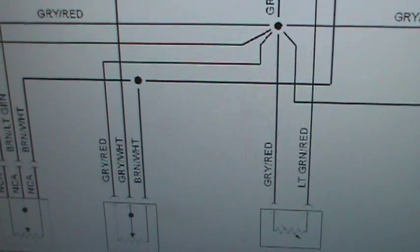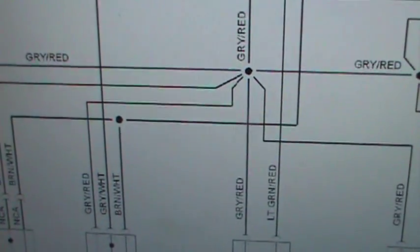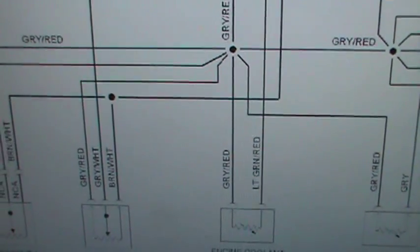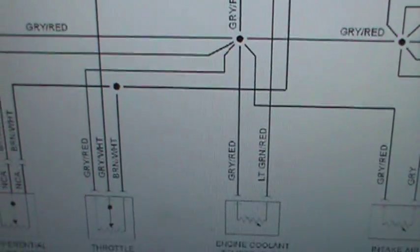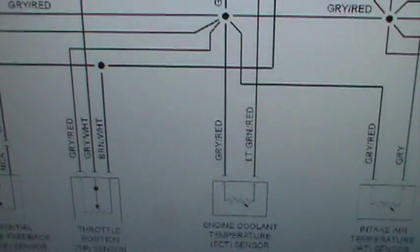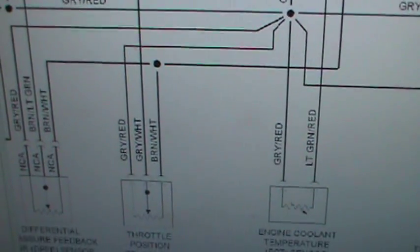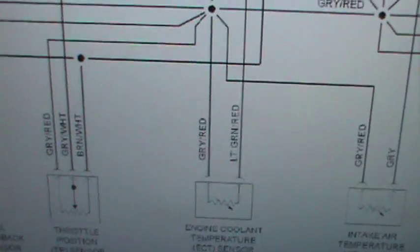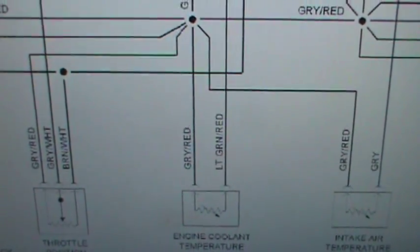You pull up the wiring diagram, you want to see which one's the signal wire — boom, one in the middle. You want to see if it's getting its five-volt reference. Which one's the five-volt reference? You don't want to ground out that five-volt reference. So you come and you check — cannot be shared, so that has to be the ground. Therefore, brown and white has to be the power. Done. Same with this: if the gray and the red is shared with the potentiometer, that has to be the ground. Therefore, you tap into the light green and red — that one's the signal wire. Done and done.